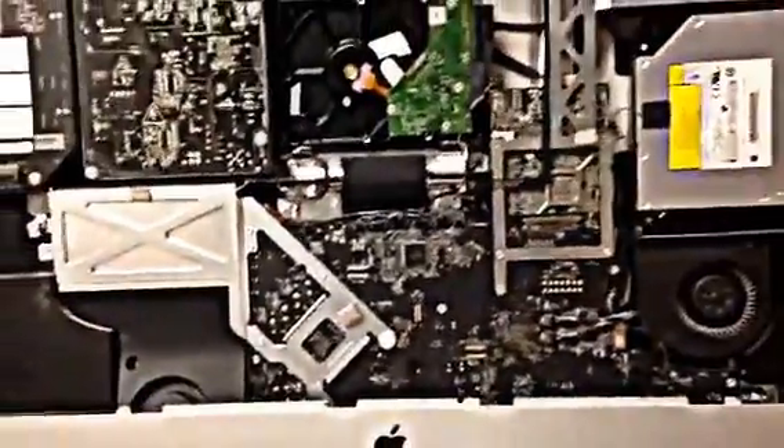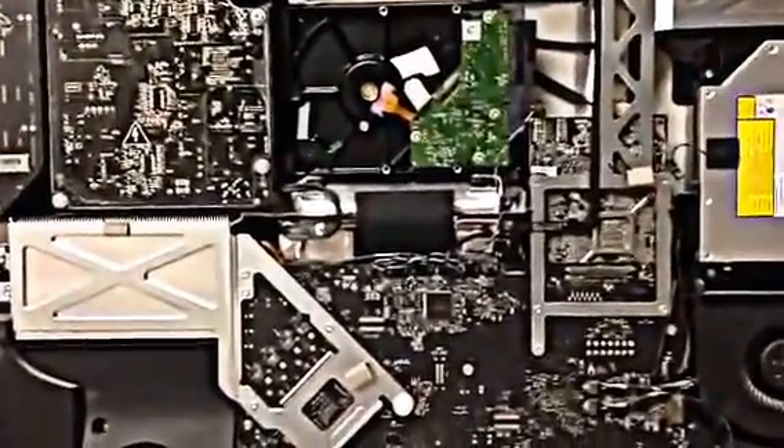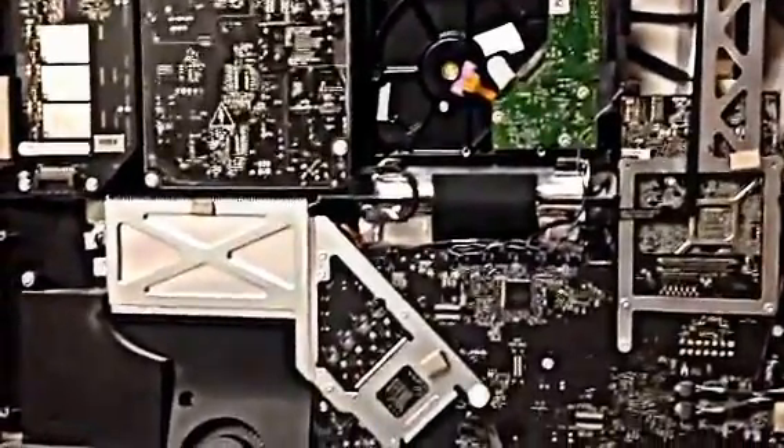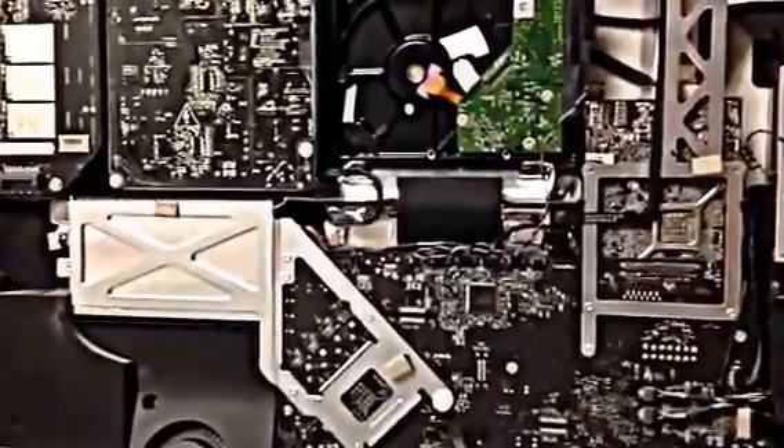If you're a technician opening one of these, definitely clean the vents — dust is a major problem inside computers. We take the whole motherboard out, every single piece, and make sure there's no dust underneath. We also take care of the thermal paste. If your iMac is really hot in the back, you may want to repaste the CPU and all the video chips, because over time the thermal paste dries up. Without thermal paste, you'll see a lot of overheating on the video card, and heat is one of the enemies of electronics.